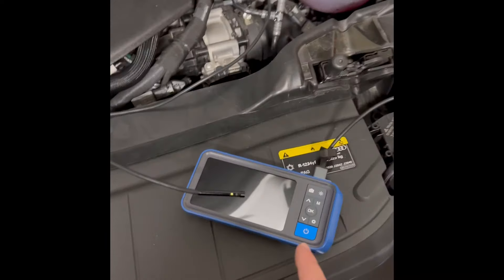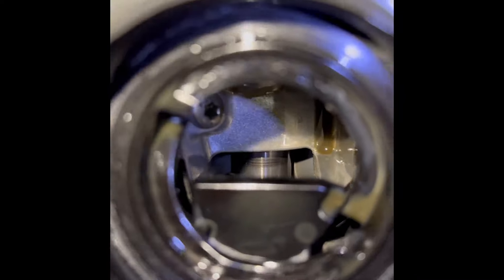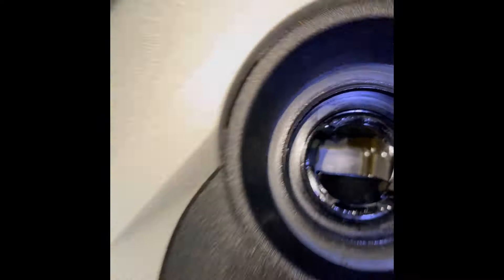You're going to need a bore scope for this inspection. Moving on to the initial inspection, go ahead and power on your bore scope and make sure the light is on. What I like to do is position yourself right over the camshaft — it doesn't matter which one. You're going to want to go to the left of the camshaft, hooking the bore scope away from you, going down right to the left of the camshaft far enough so you can see that rocker arm.